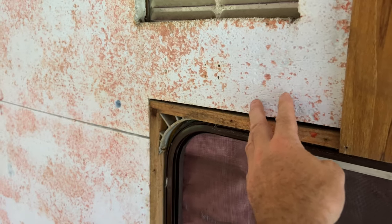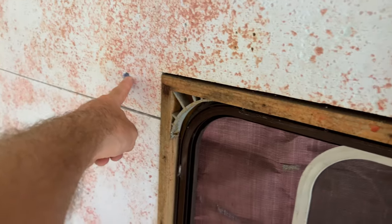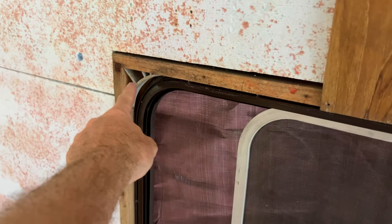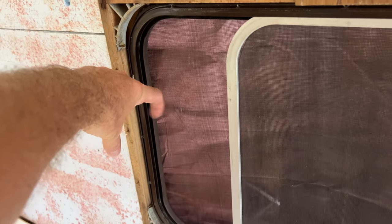There's no support at all in there - you can imagine driving down the road with that whole thing blowing away. So I drill a hole here and I'm gonna inject some adhesive through here, put some adhesive all the way around so this is nice and solid, and same in here so that that frame is solid. Then what I'm gonna do is when I install the panel, staple it on, and then clamp the two together.